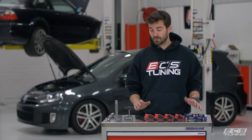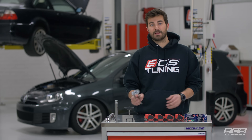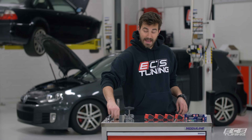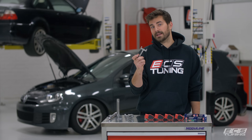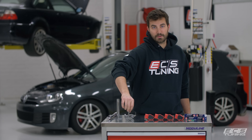It's going to be pretty quick and easy. Just a few tools necessary, mostly for the spark plug portion of things. We're going to be using a 3/8 ratchet and extension, our Schwaben spark plug socket, a spark plug gapper to check the pre-gap plugs, and a 3/8 torque wrench. This isn't necessary, but it does make it a lot easier to pop your coil packs out.